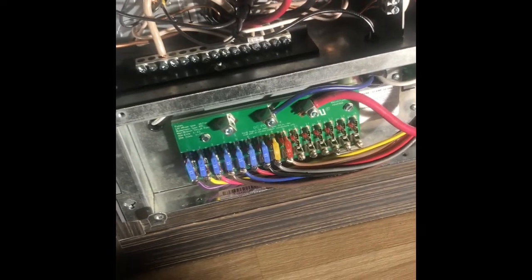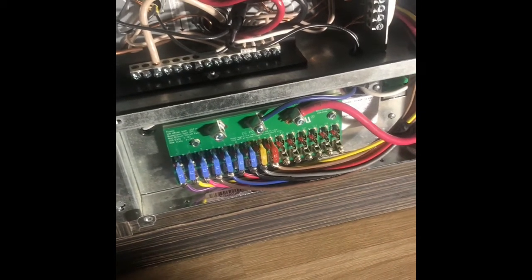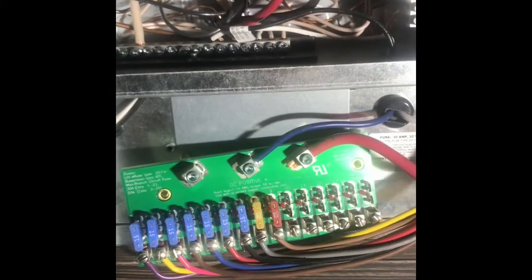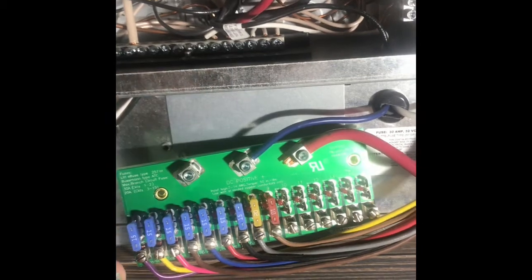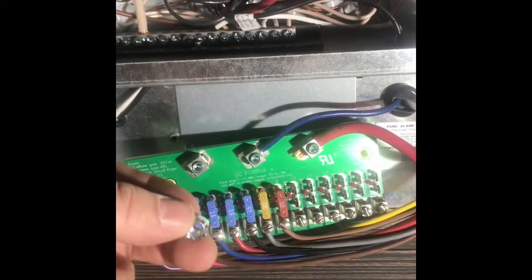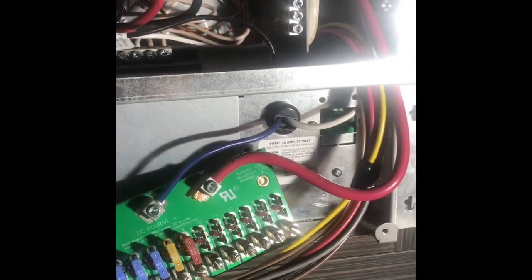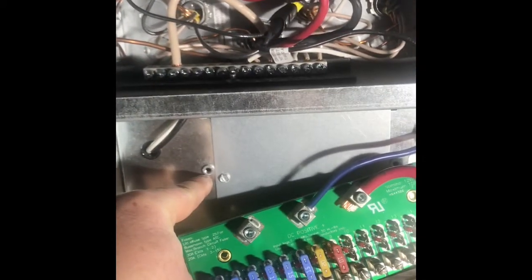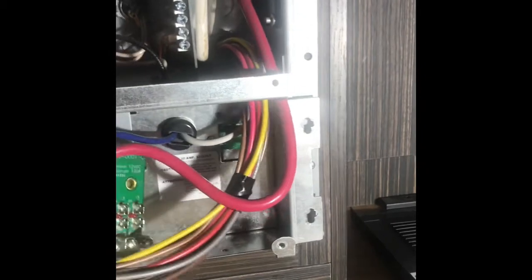And then next we're going to take the fuse board off and pull that to the side so that we can begin pulling the chassis out. Okay, I've pulled the screws off that hold the fuse board. Just to let you know, on this one there was a nut on the back of this particular board. It looks like the bolt passes through here into this nut and then also into the hole back here. The nut dropped off, so you want to put that to the side, and you can see the board just sort of swings away.